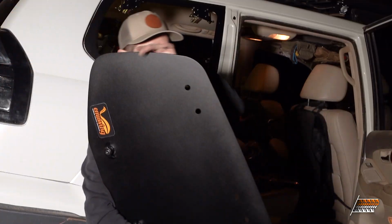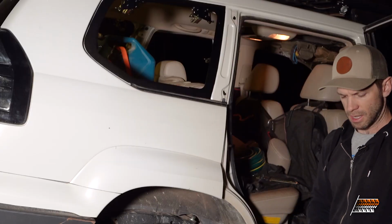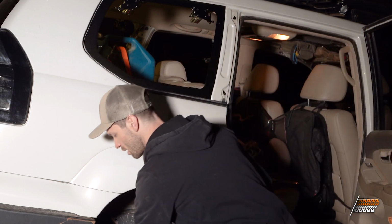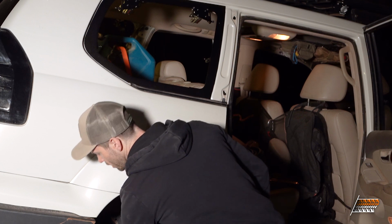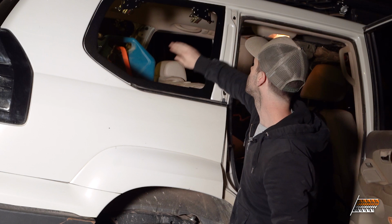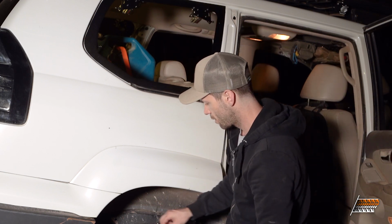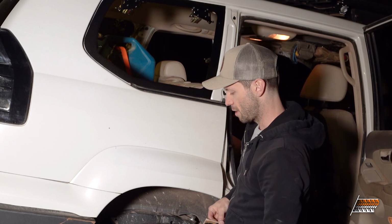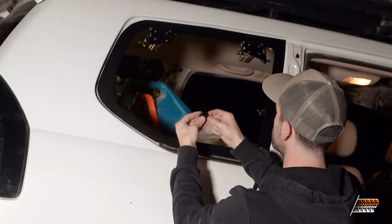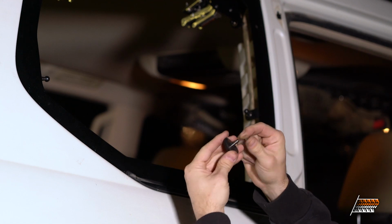All right, this is the cool part, right? There's some special nuts that come with it, like this. They cover up the holes, and these holes allow for a lot of compliance and movement, which is really great because it's kind of difficult to get everything lined up perfectly between frame mounting locations, these, and everything. It's best to start with 2 just to get the wing placement right. And what happens is when you tighten it, there's a little rubber washer here and it squishes out, and I try to make it nice and uniform squishiness, I guess.